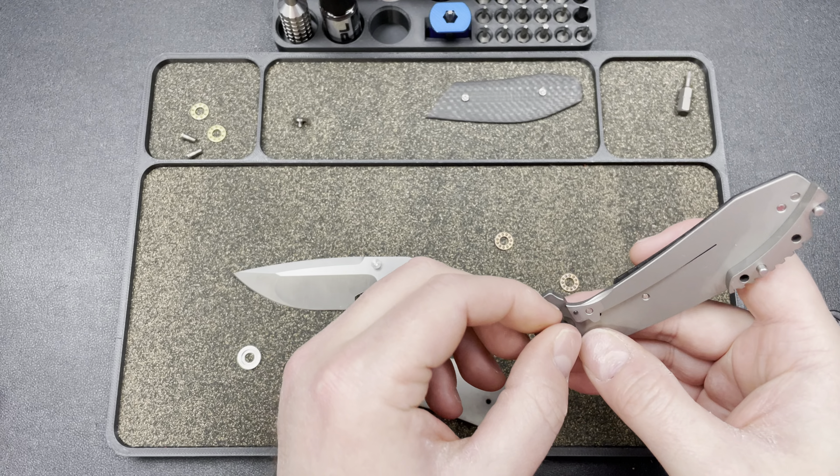Now I cleaned it all off — damn it. I also don't want too much on there. There, that should be good. That whole detent ball is riding on there versus just the top of it. You can definitely have more issues with detent lash if you don't do a flattened ball, because you have more room for error. Anyway, drop that on there.